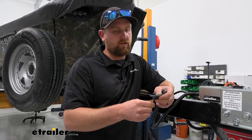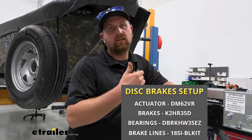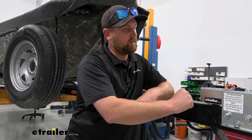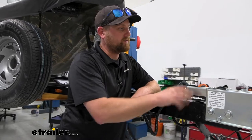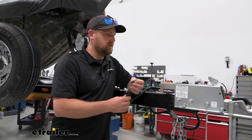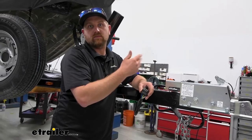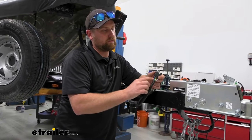On our boat trailer, we're adding disc brakes. When you add disc brakes to a boat trailer — or brakes for that matter — you're going to have a surge type actuator in the coupler. And depending on which one you have, some of these have an electric reverse lockout. So whenever the reverse light signal goes in, it won't lock up the brakes and will allow us to back up. That's why we got rid of our four-way and hooked this one up.